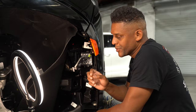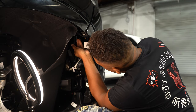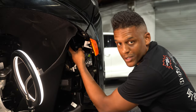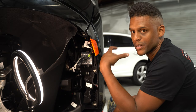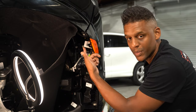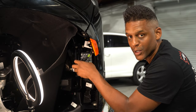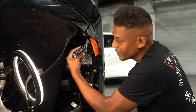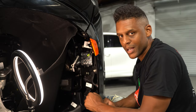So that you don't forget, I recommend placing the plug back in that hole so you remember where it needs to be mounted. I've seen too many times where this doesn't get plugged back where it's supposed to and the wire just sits there moving around. On a Cadillac — a luxury automobile — you might end up hearing a vibrating or knocking when you hit a bump. You also don't want the wiring to wear out over time from too much movement and the pins backing out from the plug.